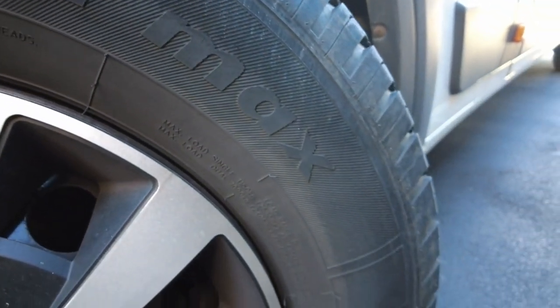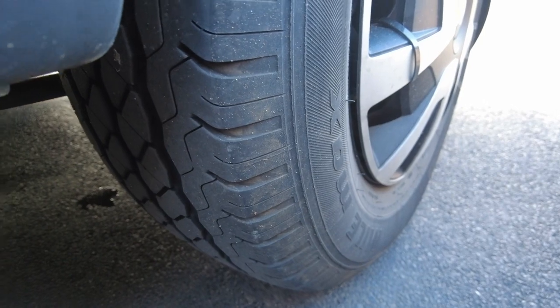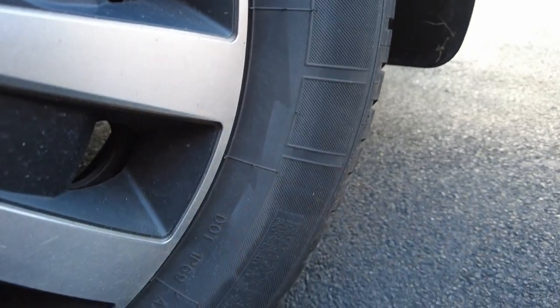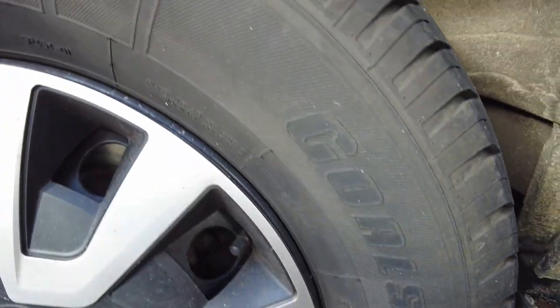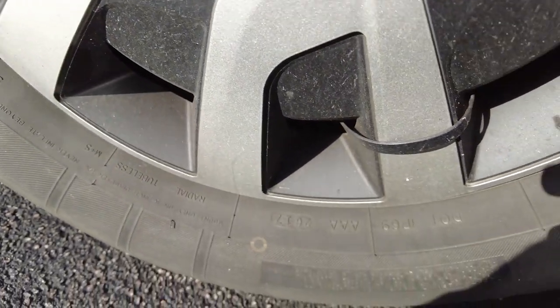The sidewalls look fine. The rear tyres on this have got plenty of meat left on them, and I've had a puncture repair done on one of these. All four tyres are going to get changed anyway. As a visual inspection, just go around your sidewalls and make sure there's no cracking. Checking the date again on this one — the 26th week of 2017 — so again they're getting to the point that they need changing. The driver's side rear has got plenty of meat left on it on the tread, and the sidewalls look fine.